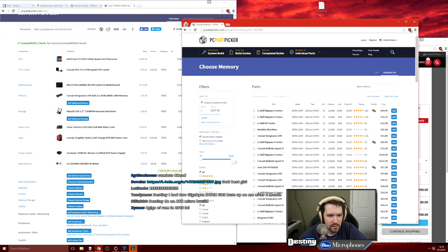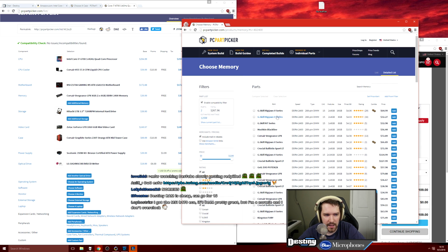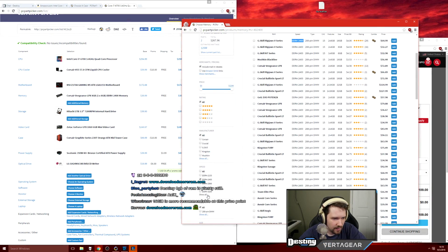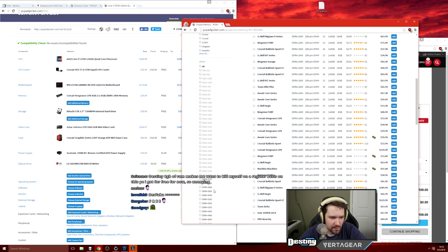Now, remember, boys, your speed is a function of two numbers, okay? It is the frequency at which the RAM runs, so 2400, 1866, whatever the other numbers are. I don't know, dude. 2666, 2800. But it is also a factor of your CAS latency, okay?